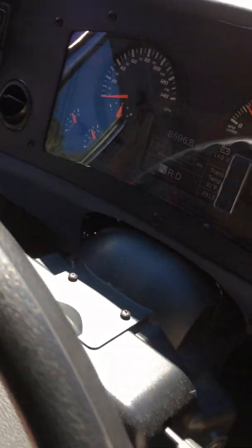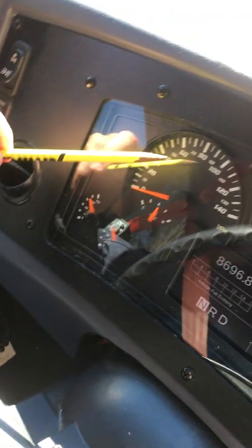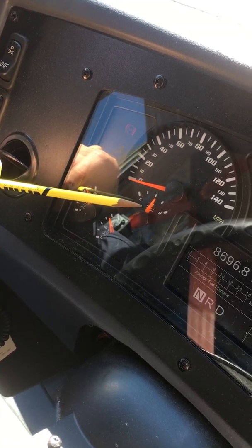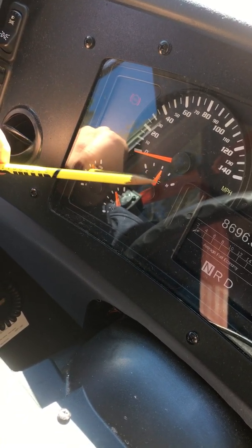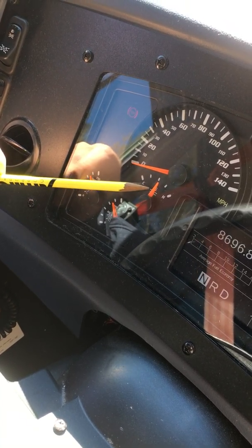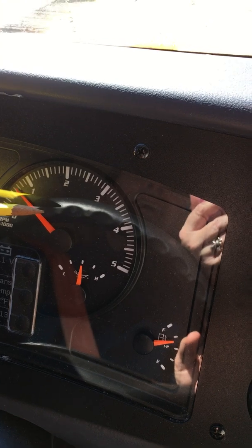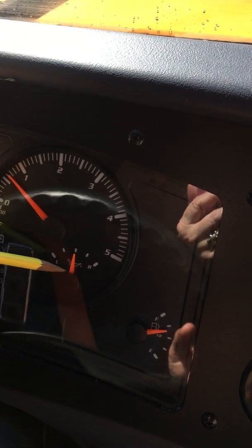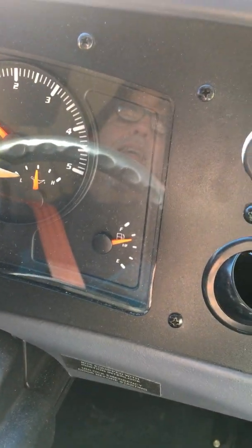And then when I'm done doing that, I can talk about the different gauges on my switchboard. So there is the speedometer over here. There is the temperature gauge over here. It should read between 180 to 190, not to exceed 220 Fahrenheit. Over here it's not that detailed, it's just pictograms, but I will mention these figures anyway. It's pretty much standard whenever you pre-trip. Over here, that's the tachometer, so your RPMs basically. And over here, that is the oil pressure gauge. Normally it should be between 40 and 60 psi. Again, you don't see these numbers on the dashboard, but these are the numbers that are pretty much standard.